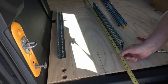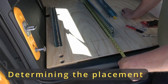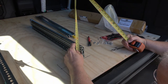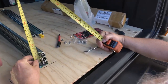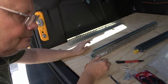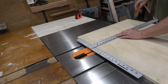We have 48 inches, which is a little more than we need — 40 would bring us to there, but that would leave a little bit of space behind the driver's seat. Now that we knew where we wanted the tray to sit, we needed to take a few measurements to determine the actual size of the slide-out tray. These glides that Eric bought are heavy-duty 300-pound glides, and one of them even has a locking tab. In order to build the tray, we transposed all of our measurements back onto the plywood downstairs.